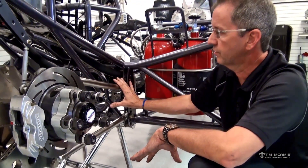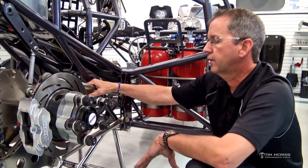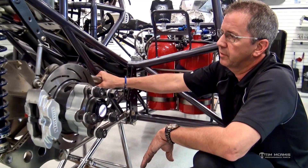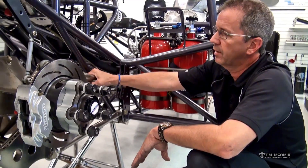It could be something on this side of the car, that side, up in the front of the four link, housing bending or flexing — lots of different things could cause that. But it's an indicator that something's changing, so you should look around. After a car has been worked in and has a good set on preload, it shouldn't change — it should stay the same.